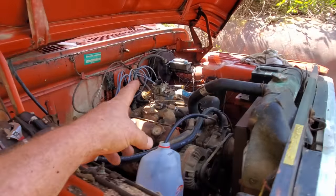She's been sitting there idling for, I don't know, 10 minutes. And as you can see, we ain't got no fuel pump. I even moved the tank on the ground there so it didn't have to lift so high going over the bed. Still ain't pumping. Spent a little time adjusting the carburetor. It's idling a little better, but still got a hesitation. Well, let me just show you.